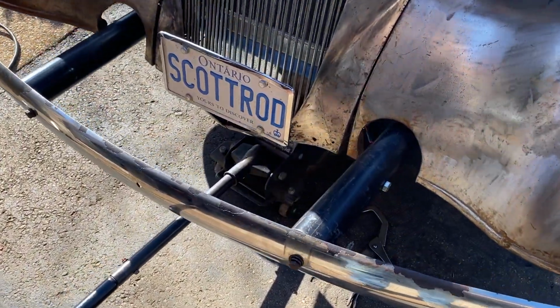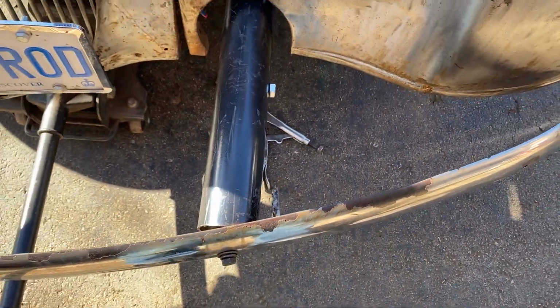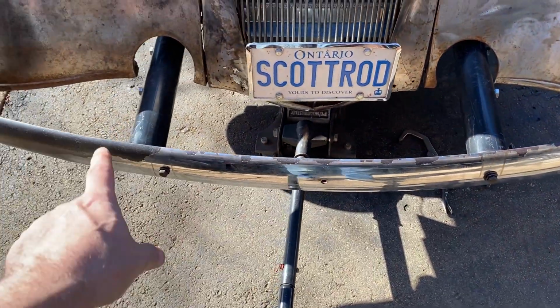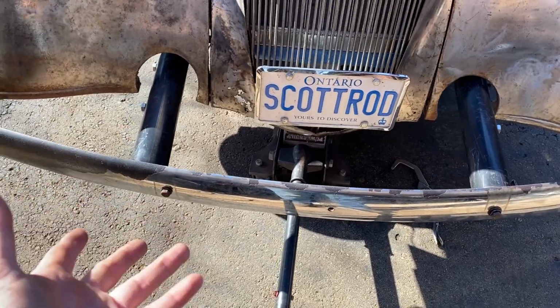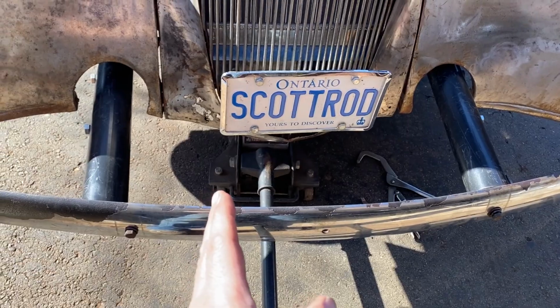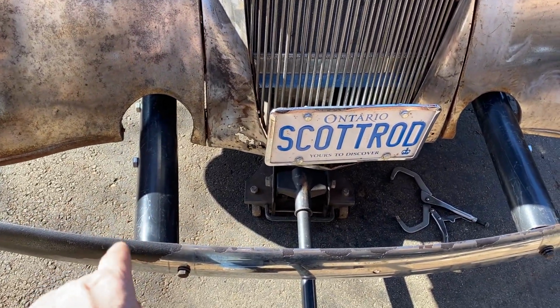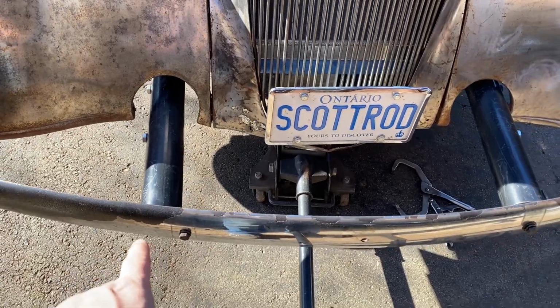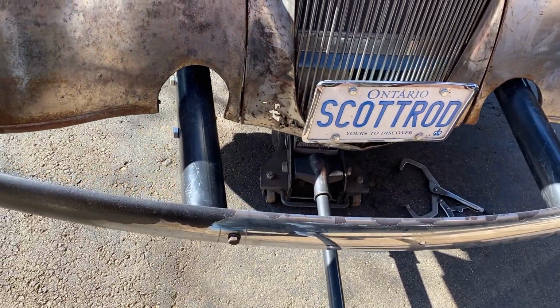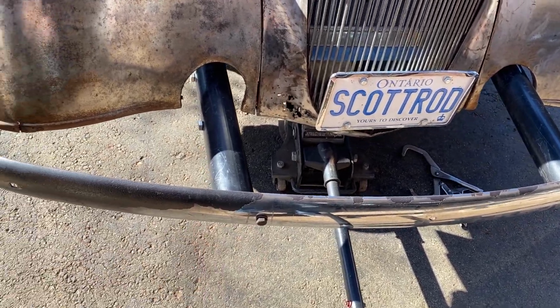Right, I cut those tabs off and they might work. It's sitting over that way just now because it's just hanging off the end of the pipes so that I don't have to use clamps to show you what I'm talking about. So the whole thing's going to come over this way a bit. Those bolt holes will be behind, kind of inside the tubes. So what I'll probably do is weld on a couple of captive nuts at the back on those plates. And then I just have to screw it in from this side.